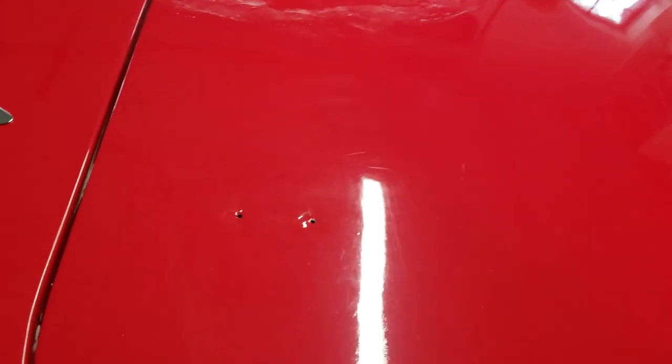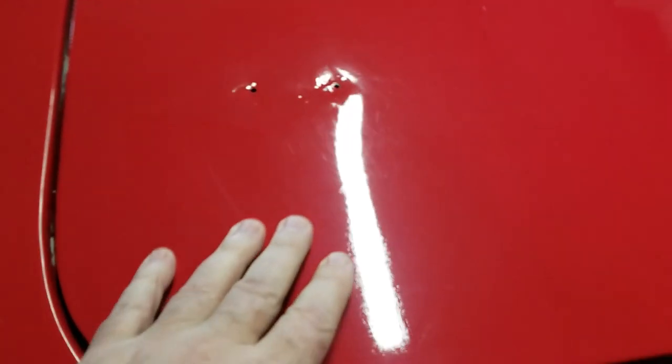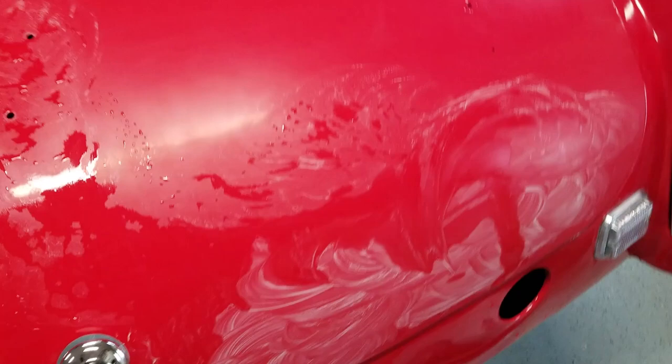If we can get good focus and zoom in, when you do your clear coat you're going to get some orange peel. We've knocked it down a bit after about two days, but there's still some finish work to do. You can see how the light is breaking up on the edges — it's kind of an eggshell or orange peel. It's just not absolutely flat and shiny.